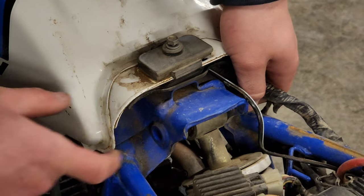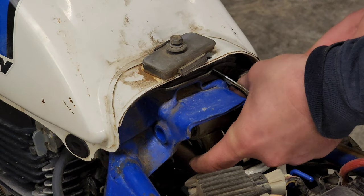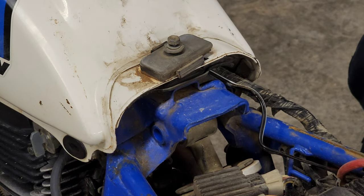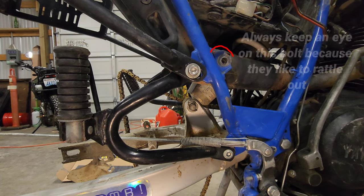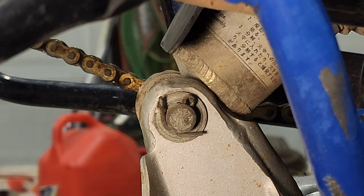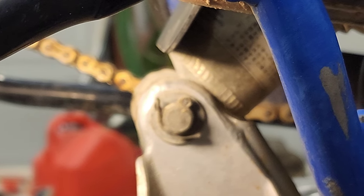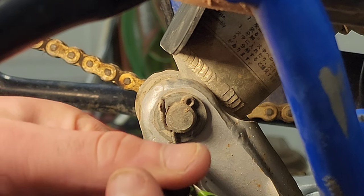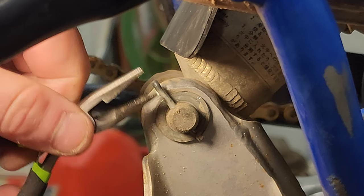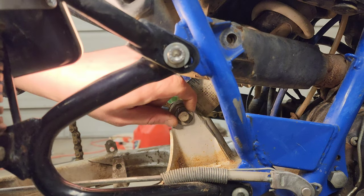On this side you have the little wire bundle there, so just be careful. You have to pull up on it just a little bit so you can clear it out. There's the top popped out. Now we're going to take out that cotter pin. Try to bend the ends down — you can kind of spin that around too, doesn't have to be straight up and down. There we go. You got a washer right here, pop that off.